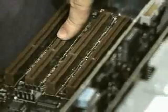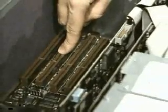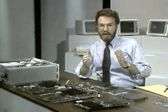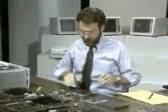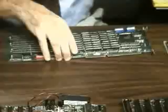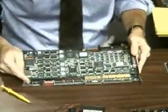They don't look a lot different, but let's look at one anyway. Down here in this EISA machine, that's what an EISA slot looks like. Note that it looks very much like an ISA slot, but it's higher. That's because EISA slots are double-decker slots. The top part of each connector supports ISA for backward compatibility, and the bottom supports EISA. To see that, let's compare two boards. Here's the 16-bit ISA you've already seen, and here's an EISA board. You can see the EISA board projects further than the ISA board.